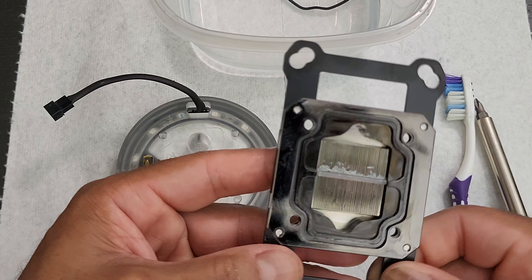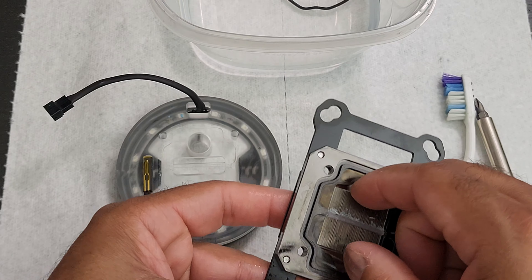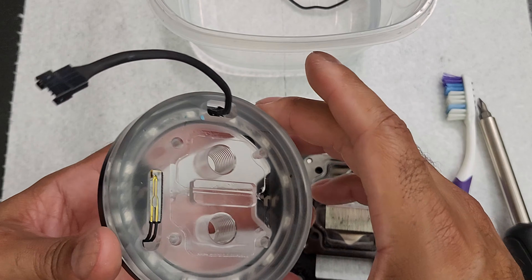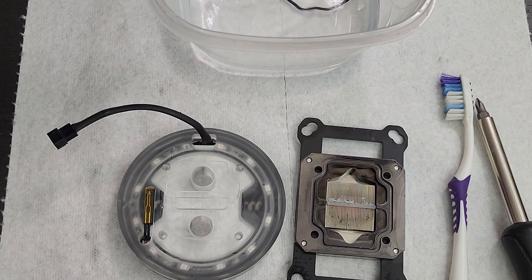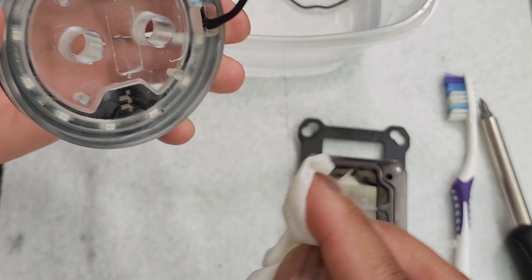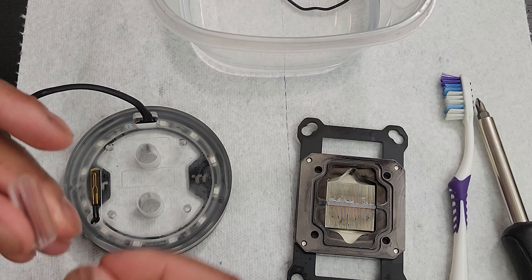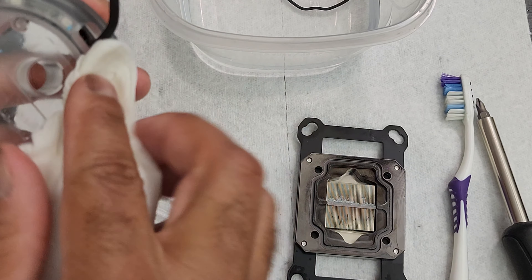This is just a simple rubber o-ring and you can let it sit in there for a little while. I've never taken this one apart before. Some blocks allow you to actually remove a jet plate - this doesn't have a removable jet plate because it's basically built into the block. So I'm just dabbing with distilled water and - oh, there we go, there was a little jet plate! Stuff like that you just never know until you work on it. The downside is I don't know which way was the top and which was the bottom, but we'll figure that out.